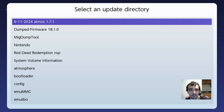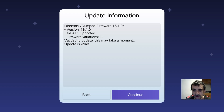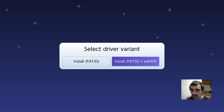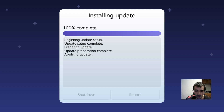Press install, then go to your dumped firmware folder and open it up. Press continue, then press preserve settings, then press install FAT32 plus exFAT, then press continue. After this is done you can press the reboot option or the shutdown option. For the sake of time I'm going to press reboot, but I always recommend shutting down then turning it back on normally.